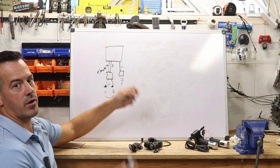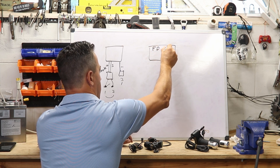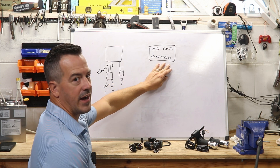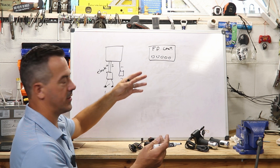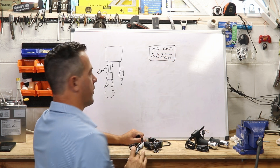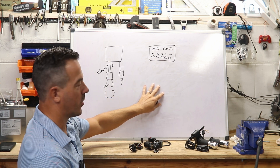The other type of controller is what we're really talking about today, and that is a FAR driver controller — we'll put FD controller. This has a lot of connections, but it's got usually five terminals on it. Other brushless controllers might have pigtails; either way, it's all the same. It's gonna have a positive, a negative, and a green, yellow, and blue for your phase wires for your motor, and those are big conductors that are gonna carry more current.